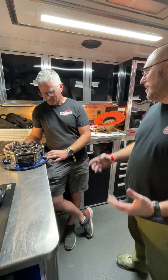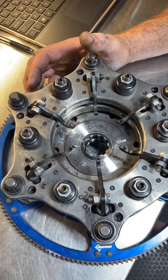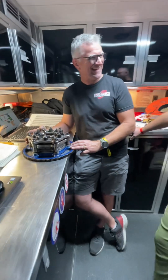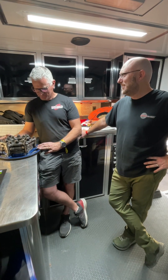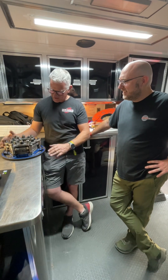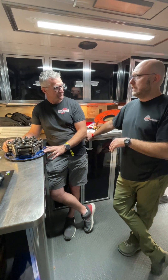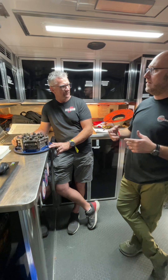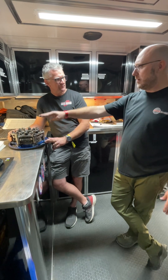That's how the clutch works on a Factory X car — it works very much the same as a street clutch, though the levers are totally different. It's a beautiful piece. With the double disc setup, depending on how far the cam comes out before it rolls over, you might be able to get away with a 7.5 or 7.75-inch cam, but really the input shaft determines that — how far you've got to clear it and whether you can fit your throw-out bearing and your stack-up in there.